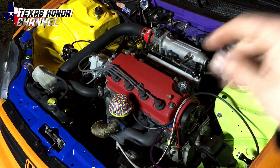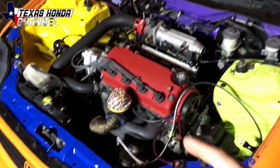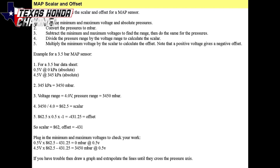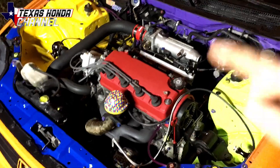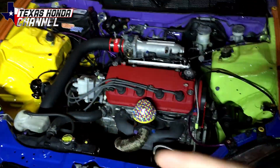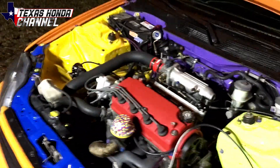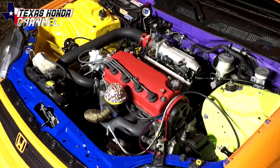Not all of them will just be drop-in and you're good to go. You will have to sometimes adjust some of the scalar and offset. There is a mathematical equation to figure that out, but we tend to just use the ones that have a drop-down menu and it works great that way. Go to Hondata's website to get it, or Pro Civic — Pro Civic has the Hondata MAP sensors as well. The Speed Factory ones I've heard are pretty good too.